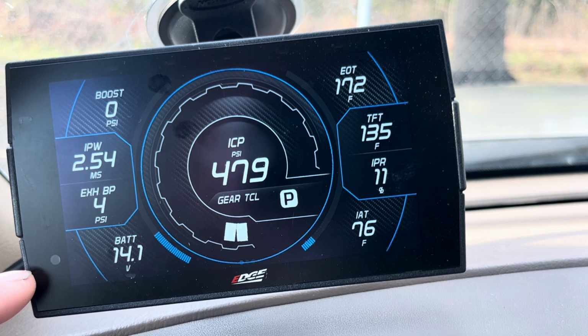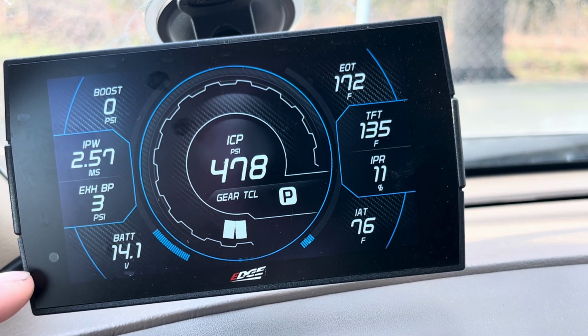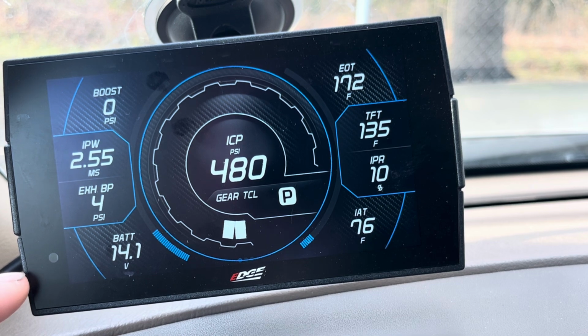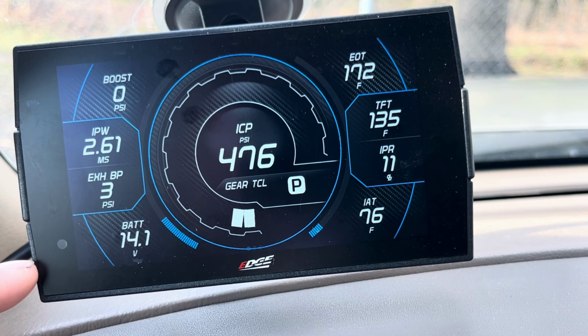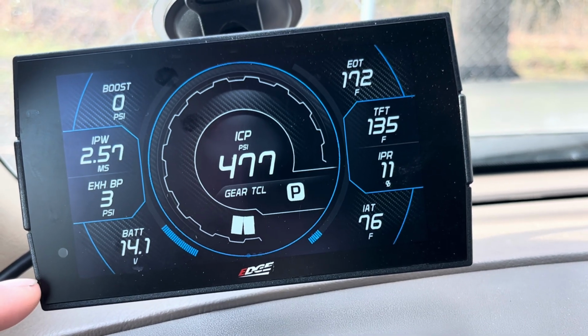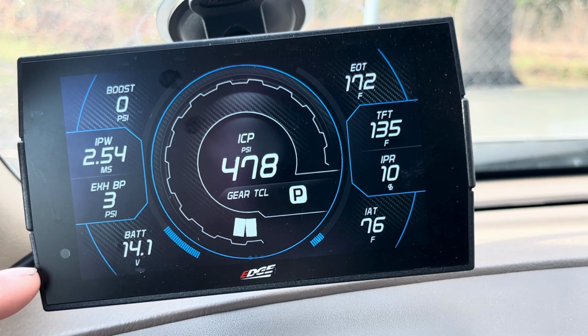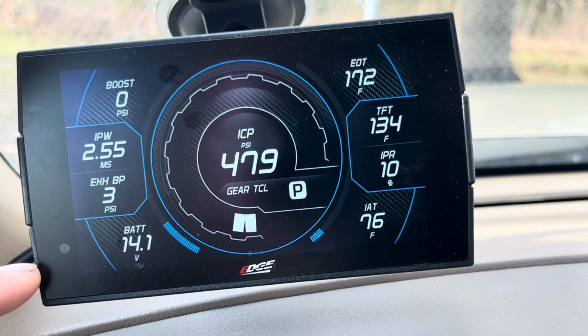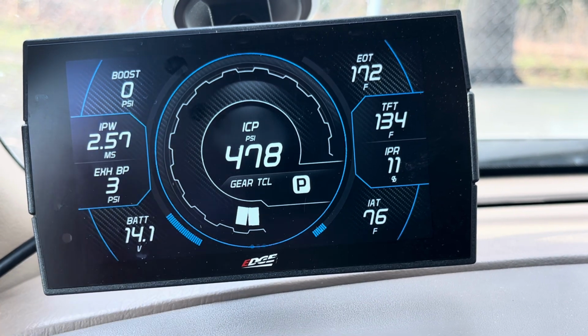The glow plug relay that the previous owner had installed had actually stuck in the on position, so the glow plugs were trying to run constantly. That was pulling the voltage down massively. Disconnect the glow plug relay, and guess what? The charging system was working perfectly fine. It was a cheap Chinese aftermarket relay, put a factory OEM one in from Ford, and it ran perfectly fine.